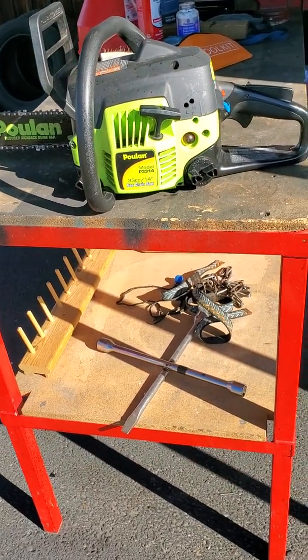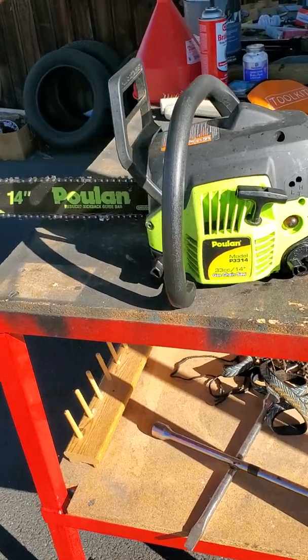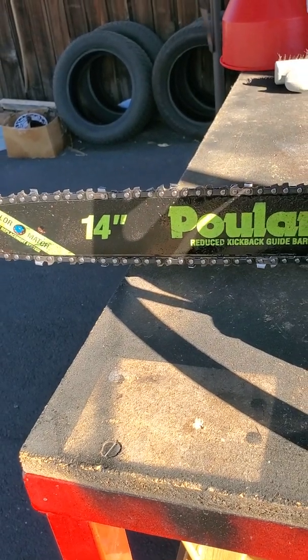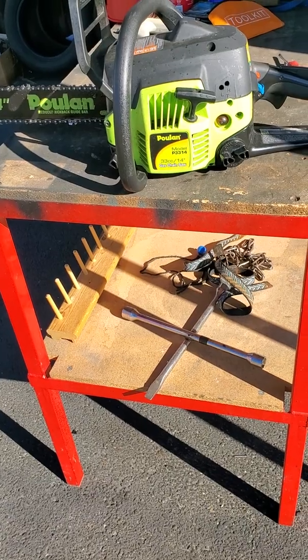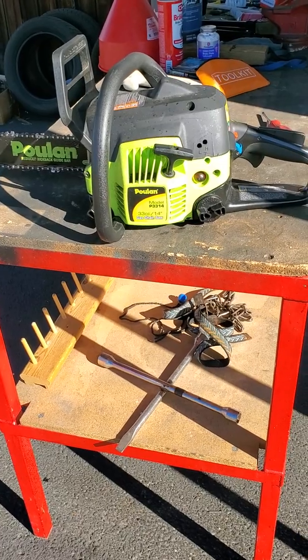It's nice to learn something. Good luck out there adjusting your chainsaws. Also mentioned in the video — you want to make sure your chain is adjusted properly. This one is just a little bit looser than I would usually run it, so I'm going to tighten that up a hair. You also want to have your air filter in — it affects the idle. Thanks for watching, and I hope you learned something today like I did.